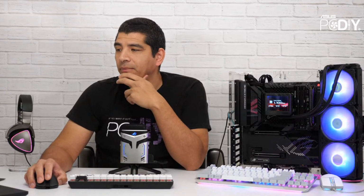I need to find a way to control RGB with... So I'm not sure about your question 100% there, Matthew, but when you're talking about ARGB type controls on our motherboards, all of our motherboards support direct control of 3-pin, your 5-volt ARGB based devices that directly plug into the motherboard. Now, if you're looking for, of course, another type of option that is proprietary, so working with a company that uses devices that have to plug into a controller, then you might have to use a controller. An example of that would be Corsair or NZXT.